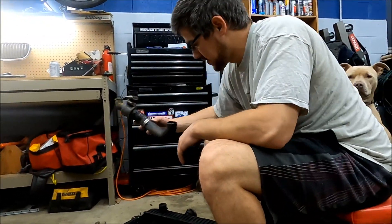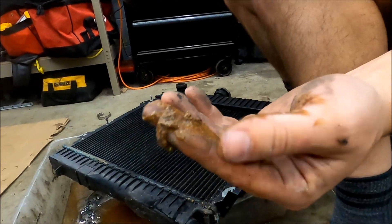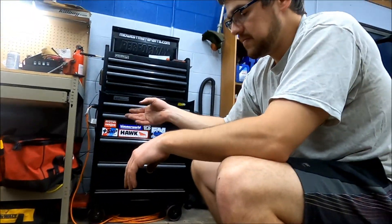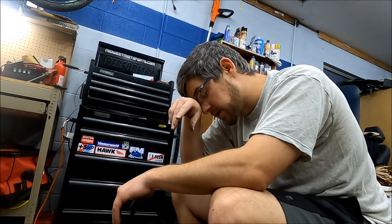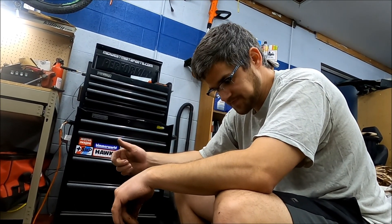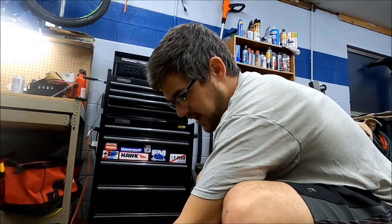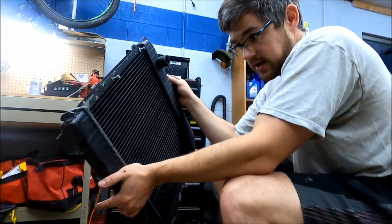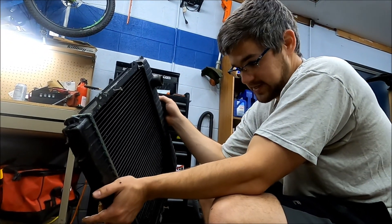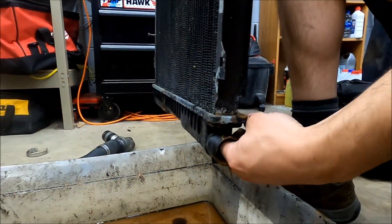We just filmed all this on time-lapse. We pulled the radiator hose off and we're greeted with this sandy gunk mixture in the hoses. So where we are — when we were getting it started, it was just dry, so we just dumped water and a little bit of coolant in it just to get some fluid flowing through it. Now that we've got the hoses, we're going to flush it and try to get all this crap out. We're draining the radiator and as you can see, it's brown nastiness. This radiator is way heavier than it should be for its size with no more water coming out — it is full of that sandy gunk.